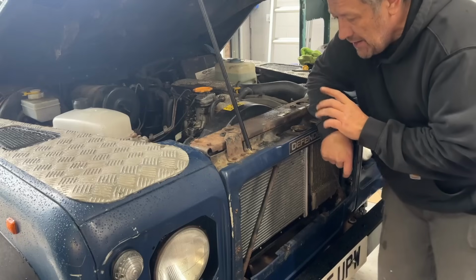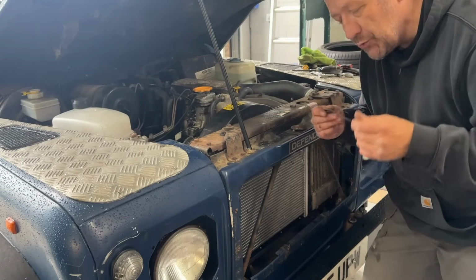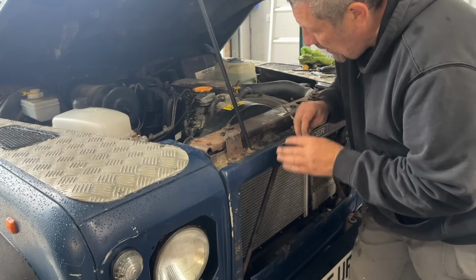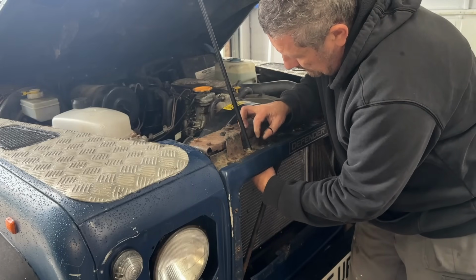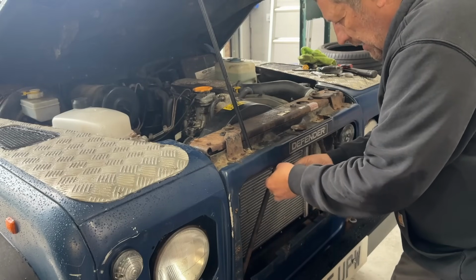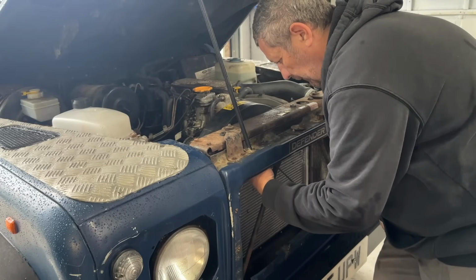And we're in. If you've got a similar situation on your bonnet and you want to install an emergency release cable, you can just get a zip tie and pop it around the cable outer housing where we put that clip. Okay? And then you tighten it up all the way to the top. You've now got